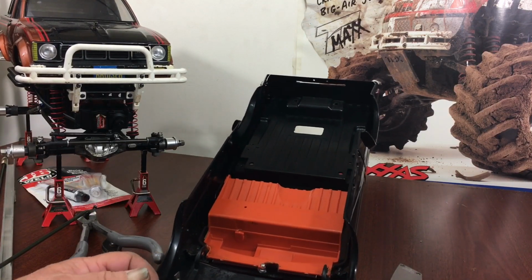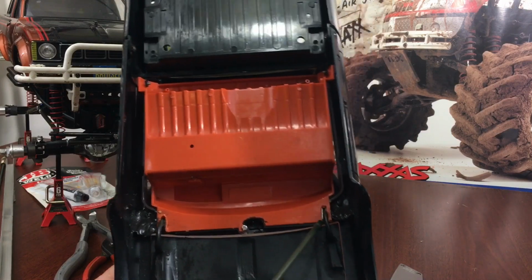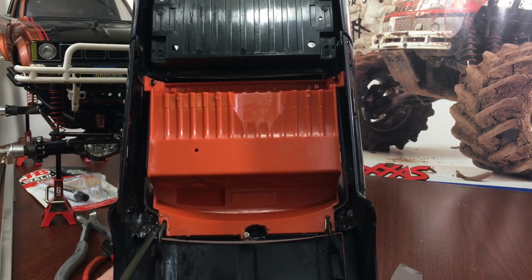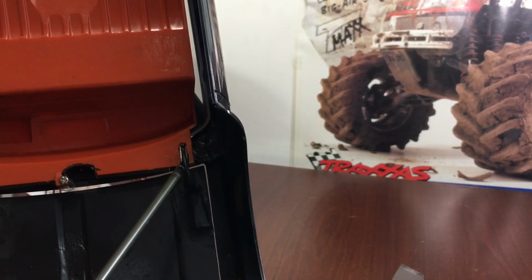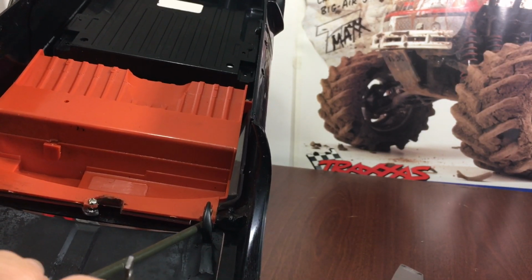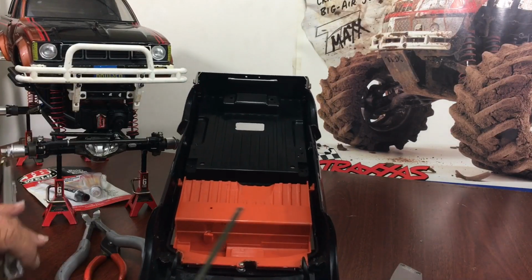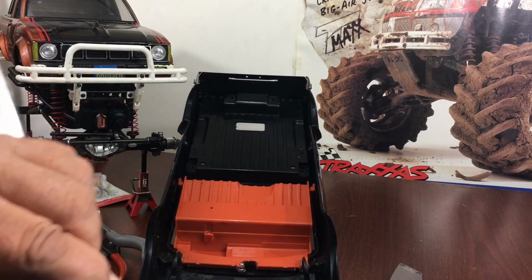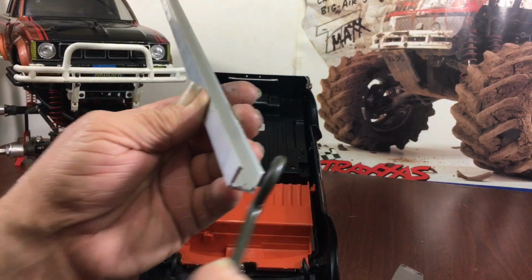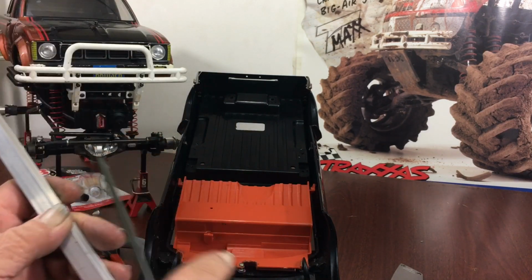So when you get your hinges made and roughed out, now you can see what I did. Where the interior mounted on both sides, I used that as a point to take a Dremel tool and burn it out a little bit. And if you look, you'll see my bracket is sitting underneath here. You're only going to want probably 3/16 of an inch high on your bracket. I preferably use 1/4 inch brake tubing and flatten it out, or any square tubing that's 3/16 of an inch high. You only need enough to put a screw through it and mount it to the body.